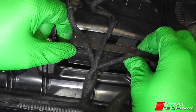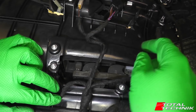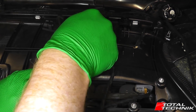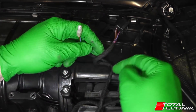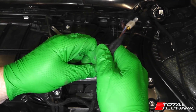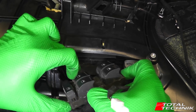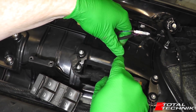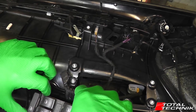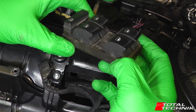It does just come through this gap here. I'm just going to disconnect a couple of connections on the door card — we've got the connector that goes into the door handle light. Twist that through 90 degrees and pull it out, and then this goes into a plastic connector — a little double hook. That's going to give me the space I need just to be able to remove this unit. So that is your main electric window switch completely removed and good to go.